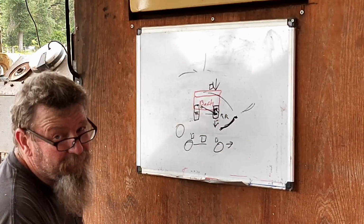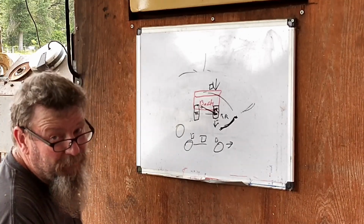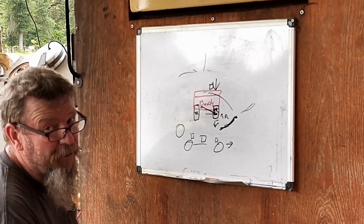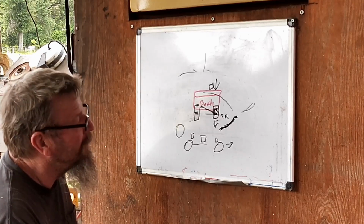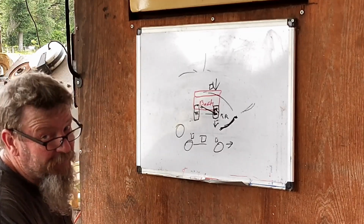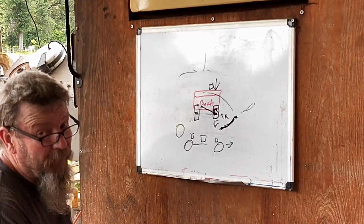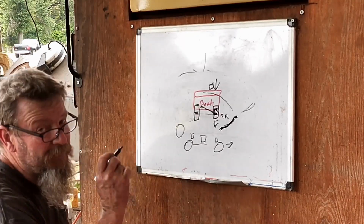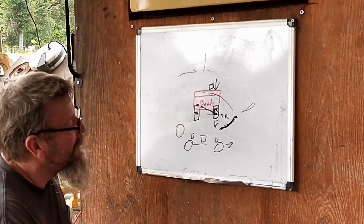If you've been running the same spring for 4 or 5 years and you haven't re-arched it or anything, get a new set of springs or somebody that knows how to re-arch them properly. I re-arch my own, but I'm not sure I do it properly. But when I drove for David Hayes, he's a badass with leaf springs, A1 Spring in Bakersfield, California. Yeah, he was amazing. The difference in side bite that re-arching them makes is just amazing.